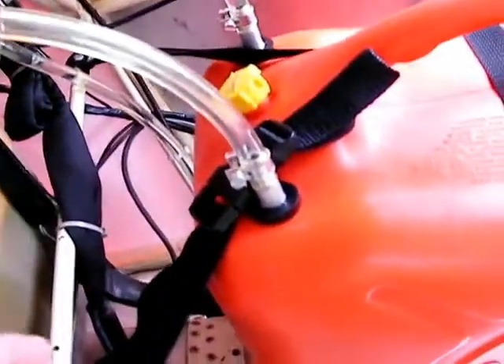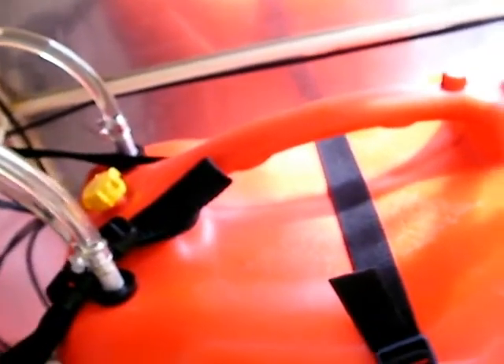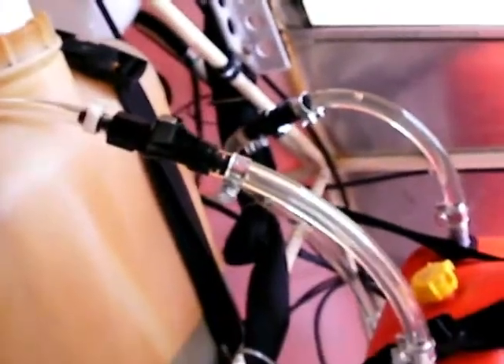If you do want to refuel in flight, you can pump it from this tank into this tank, or you can land someplace, take this loose, take this whole can out and dump it in. The tank is vented — the vent comes out underneath the plane. That's so you don't get any gas fumes in here, because carrying an extra gas can inside the plane could give you some fumes. They're both vented together and they come out under the plane.